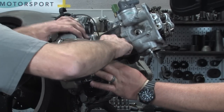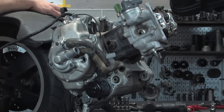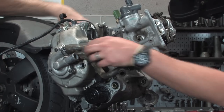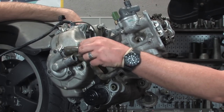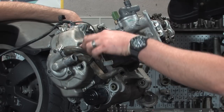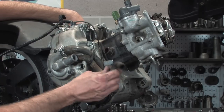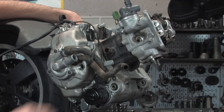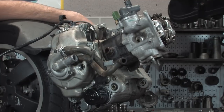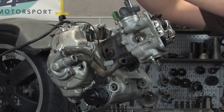They're pretty inexpensive. We stock the whole set of rubber hoses for these scooter models. A lot of times when a hose wears out, it'll get a soft spot and kind of get a little fat, like almost growing a bit of a growth there, and it'll be real spongy and soft. So that's what Robot's talking about. Yeah, and if a lot of oil's actually gotten on these lines, that would also cause them to swell and have issues.